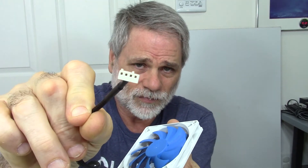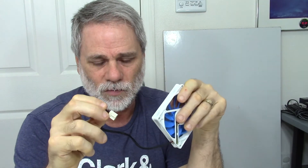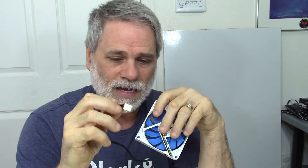I'm prepared to buy a new one if needed. These fans can be had — mine is a 92-millimeter fan, and they come in all different sizes, so you need to know your fan's size before replacing it. It's basically like plugging in a little fan, but with a connector that has two little lips on it. Those go on a slide — there's a piece of plastic inside the computer so you can only put it in one way. If you try to force it, you're breaking it, so stop and rethink.